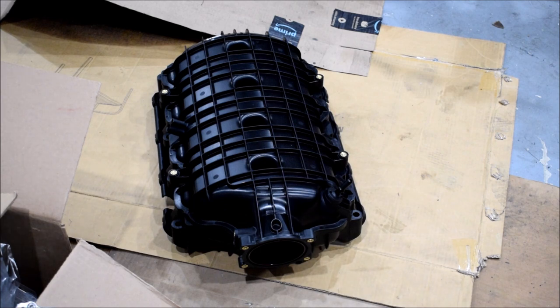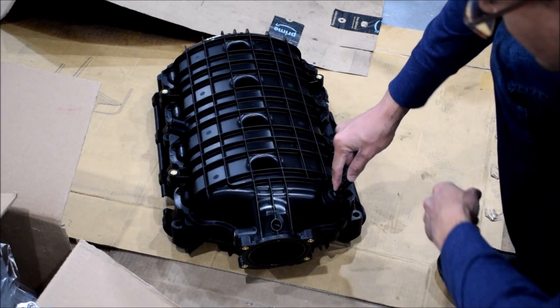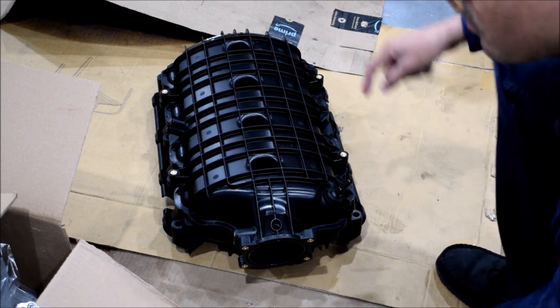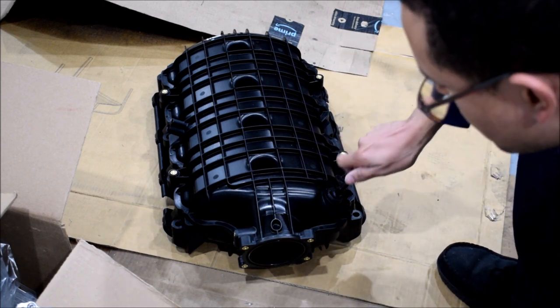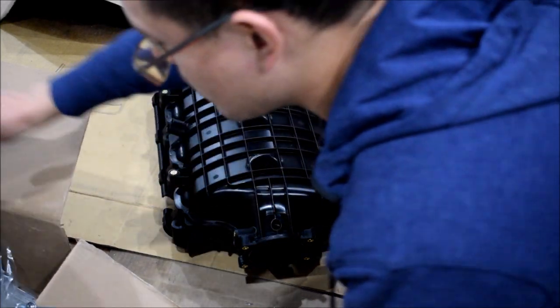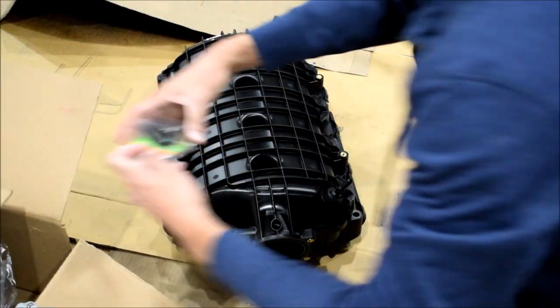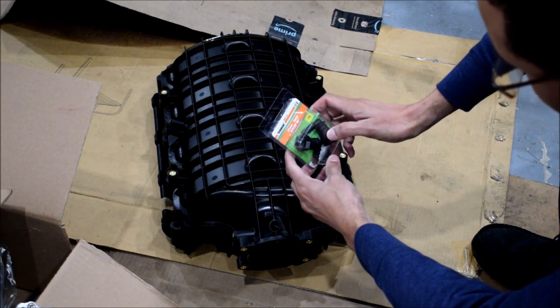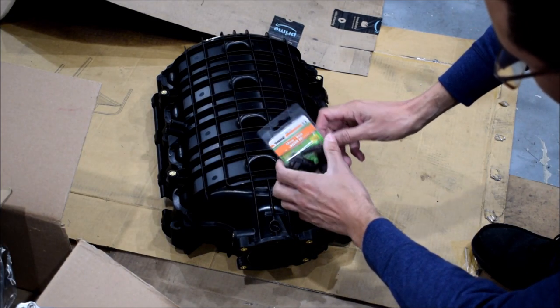So one thing that's different about these manifolds versus the LT1s is actually that breather there on the front. If you try to connect your hose here, you'd have this crazy arch. So in order to reduce that, we put an angle fitting, and I'll put the link in the description, but I got these guys on Amazon. They're made by Dorman. They're 10 to 8 millimeter nylon 90 degree connectors.